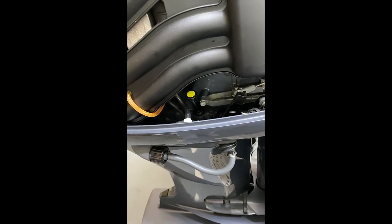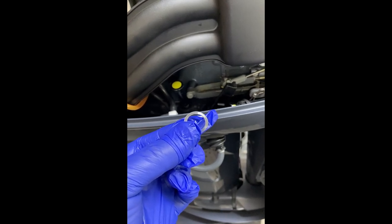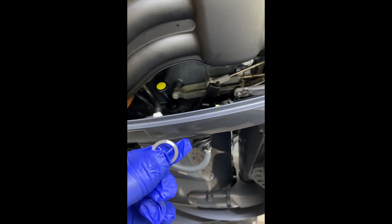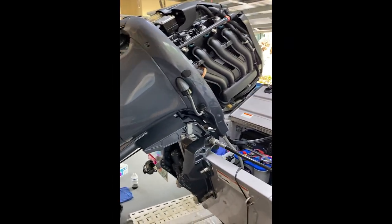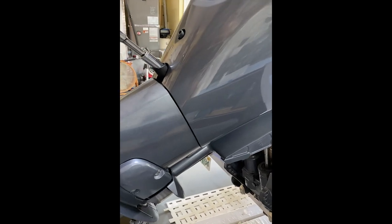I made a slightly critical error - not so terrible, but I need to put the washer back on the oil plug. It slipped off when it dropped in the pan and I put the plug back on not knowing the washer was missing. That's an easy fix - you just tilt the motor all the way up and that will prevent the oil from spilling out. I got the screw out, put the washer on - this is exactly what you need to do so the oil doesn't spill. Rookie mistake - I don't know how that got past me. We're pretty much done here.